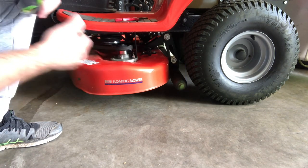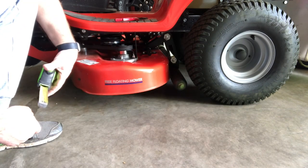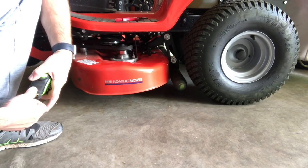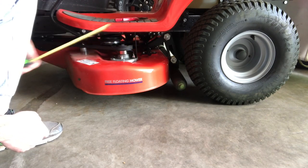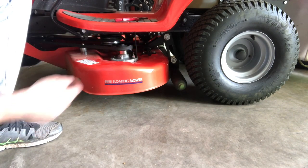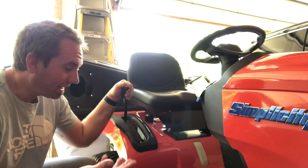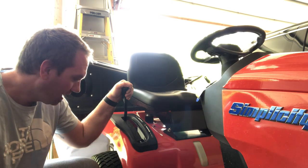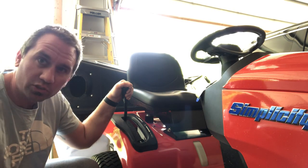So if you're having trouble transporting your mower deck and don't have enough clearance between the rear rollers, I'd recommend moving those tension cables down to that lower hole position — it'll gain you an inch and a half. I'm not sure why my tractor came set up the other way from the dealer or factory, but that's a quick way to increase clearance while in transport mode.